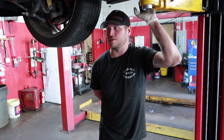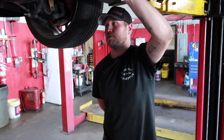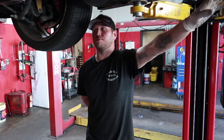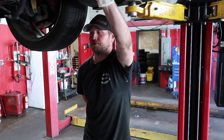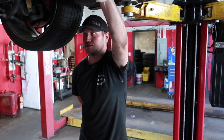What makes cars loud is the faster the exhaust flows. It's not the diameter of the pipe. None of that matters. It's all about how fast it flows from point A to point B. And if you go too big, you actually lose back pressure, and the engine will feel flat because it has to have back pressure. If you don't have some back pressure, you'll actually lose power.